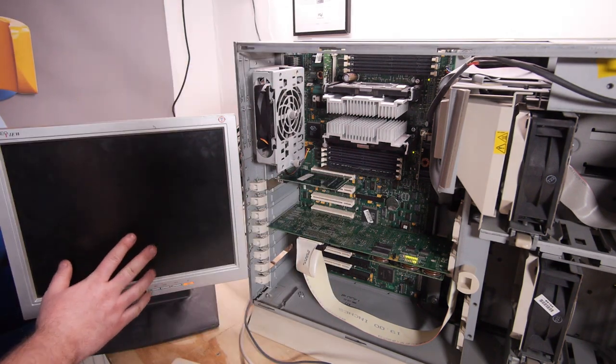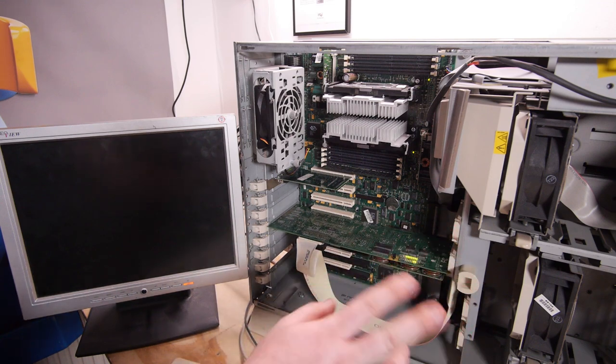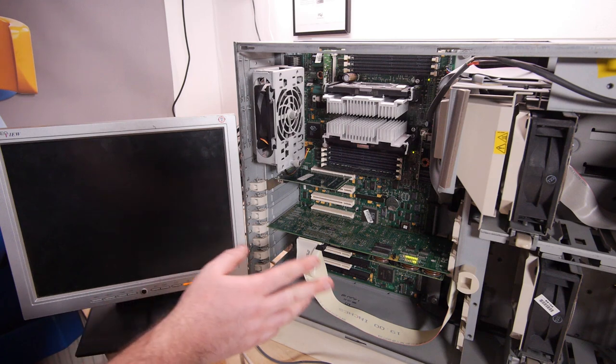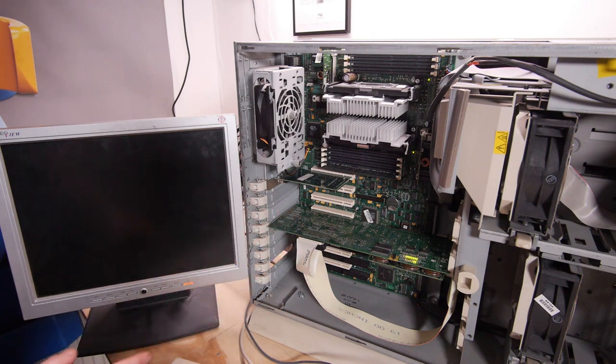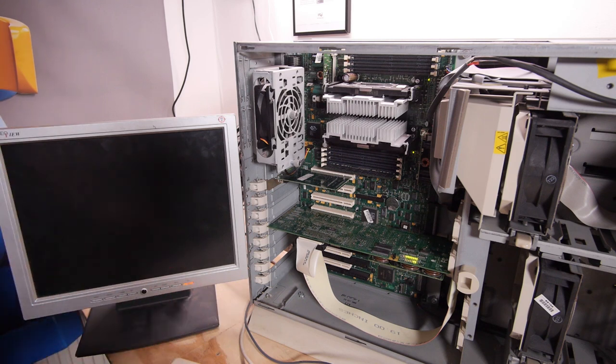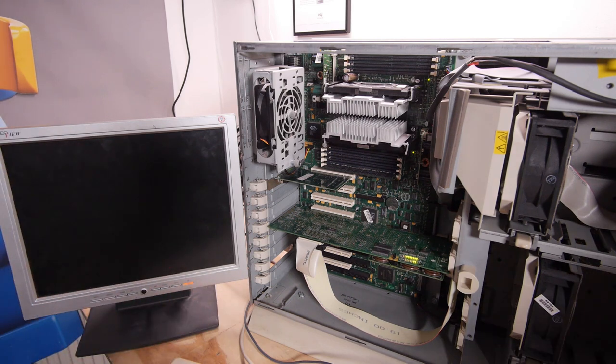It doesn't give a display, and the front display of the server is also not showing any checks. So I don't think 1 GB sticks are supported. Maybe I can see in the event log, but probably there's no info in it. The last error message was from the RAID controller that the disks were not found. Oh, memory! On the front display it says 1 GB memory.